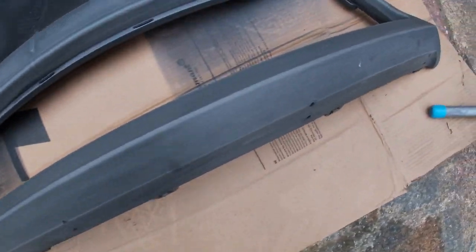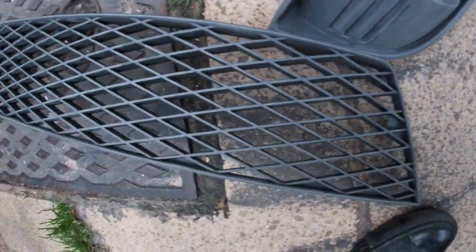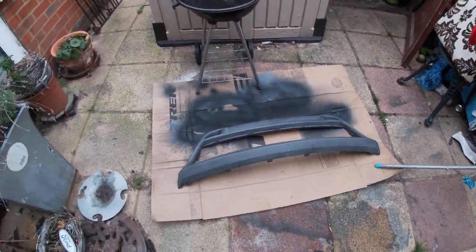So we've got everything sanded and cleaned as you can see - still needs to dry off a bit in there. The grill, the fog light surrounds, and then the lower grill as well - all done. I'm just going to prime these one by one on this box, because I don't have anything big enough and not only that, it's just going to overspray on each other. I want to get round everything as neatly as I can without messing anything up. So this is going to be a slow process but it'll probably be worth it, hopefully. Let's get to plastic priming.